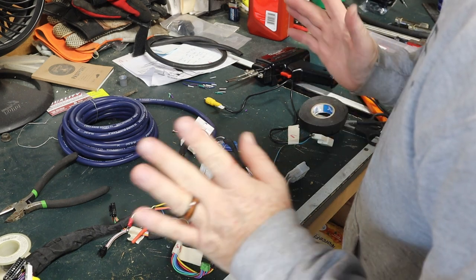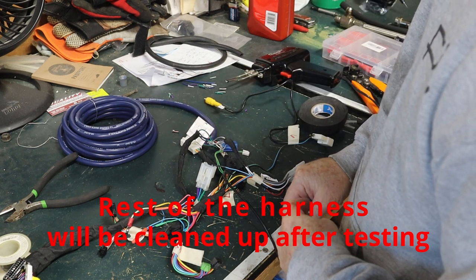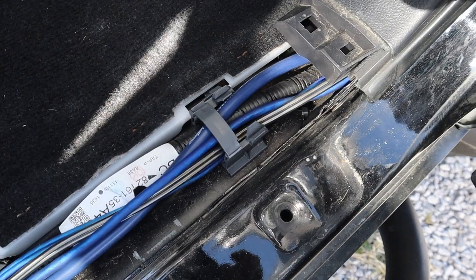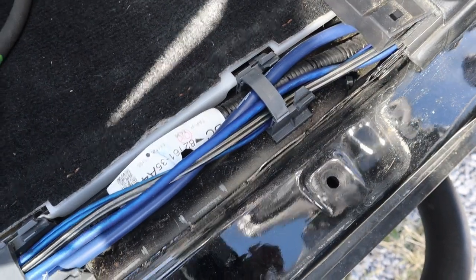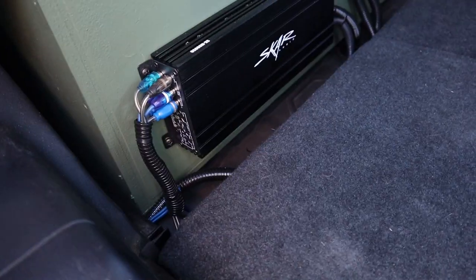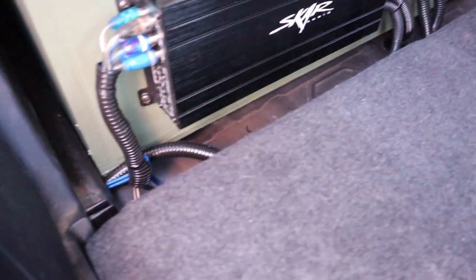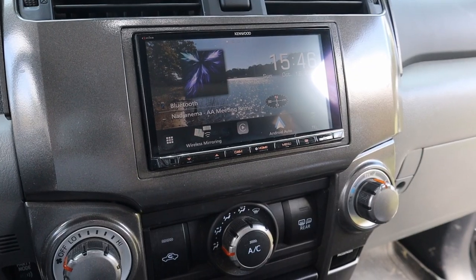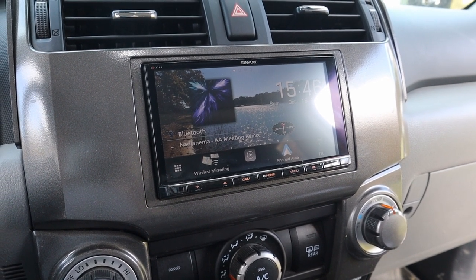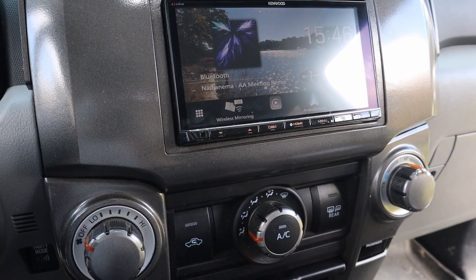I think we're ready to go ahead and get it inside the vehicle, hook back up to all the main harness, run our 9-wire back to the amp, and then repeat the soldering process. We've got our 9-wire, our channel 1 and 2 RCAs, our channel 3 and 4 RCAs, and our subwoofer RCAs ran back. Everything wired up, loomed up, looking clean. For the first time since owning this 4Runner — which has been over three years — I finally have music in all doors and a sub. So damn happy. It's loud, and it's clear.